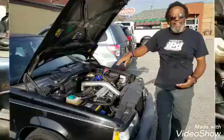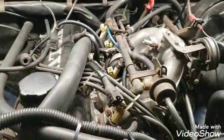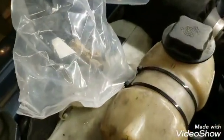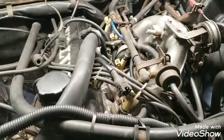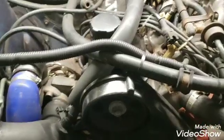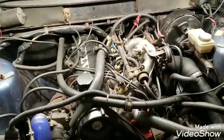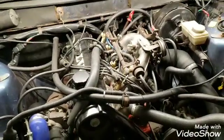Going back to the whites to get a little bit more power. These are out of like an S70 turbo and I ran them in my 850 for a while. I actually have five of them. They ran great in the 850 - they're a good swap - and we're gonna see how they do with the 15g here in the 240.